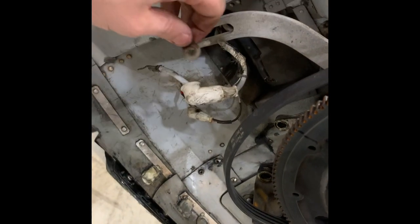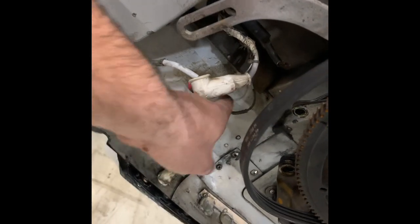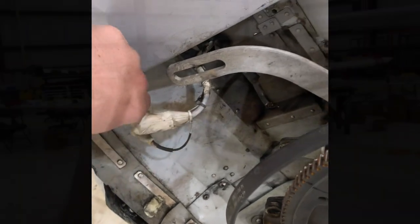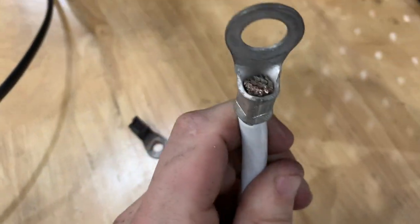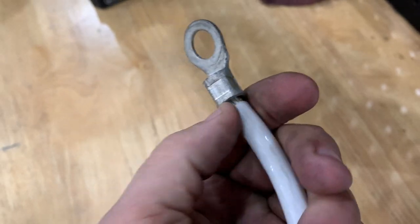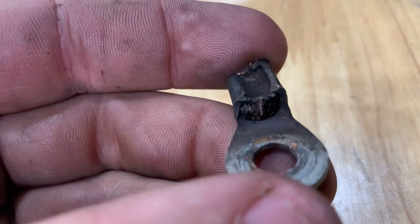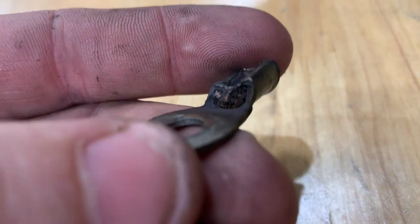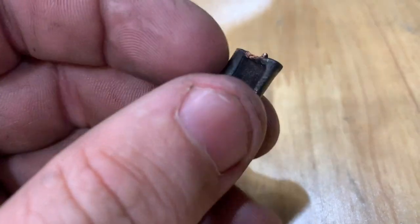So the alternator is probably good — that's why the saw test worked, because the field still works. These came off that big plane over there that they're doing a giant avionics job on. And it's a good example of what a good crimp should look like. This one was crimped with a pair of hydraulic crimpers and they crimped it way too much — way too much. And that led to it breaking off early.